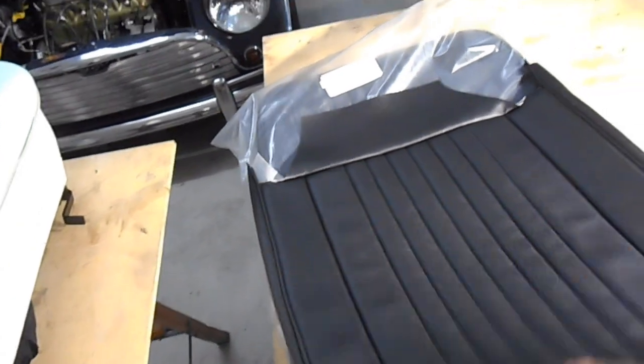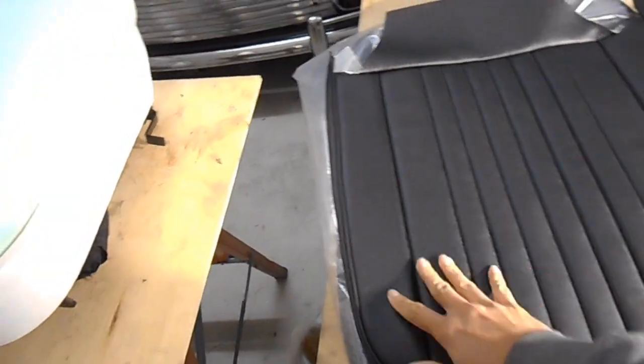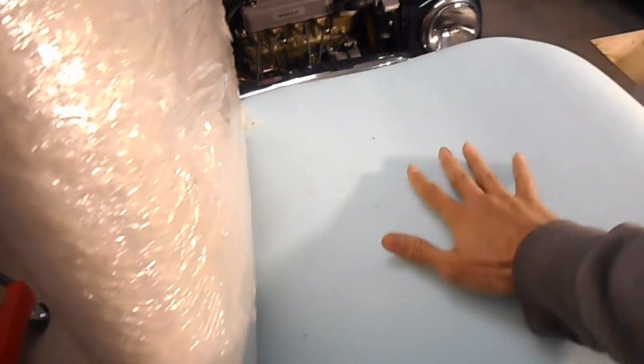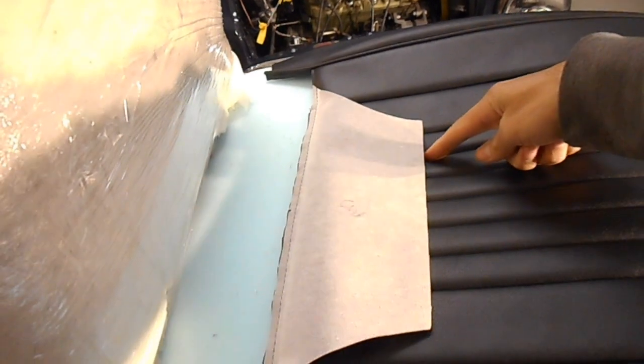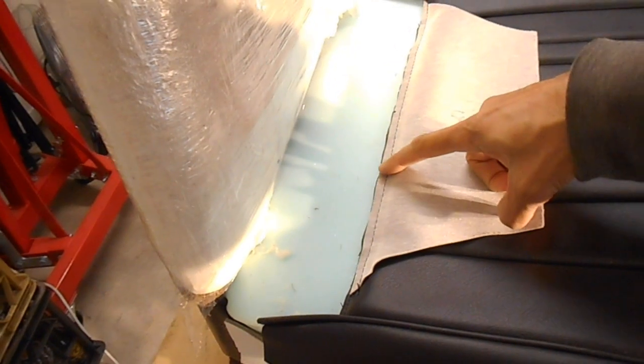Here's the actual piece that goes on the base. Depending on the seat design, you might have to do things differently. I'm going to put a bit of glue on here as well, and on the inside of here, just so when it sits on there it doesn't bulge up because it doesn't sit flat. The other thing I need to do on this flap here - you need to make a slit along here and another slit along there. You cut along here but don't go too close to that edge, because you need to get past the springs or the points on the rubber base. It's going to go through there and stick through this gap down there, and you need to have slits on it - so it will be three pieces that come down and get clipped onto this bottom bar.